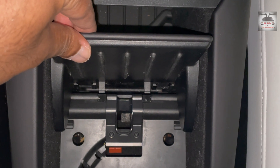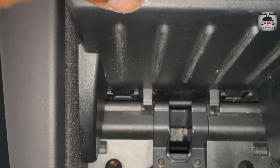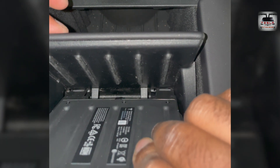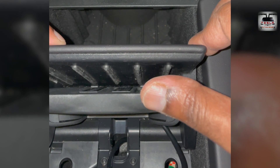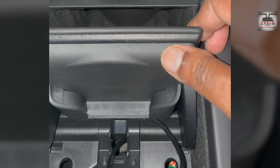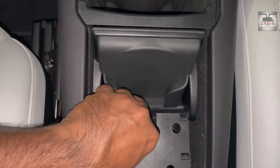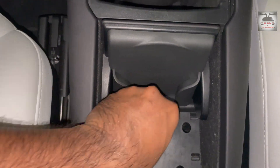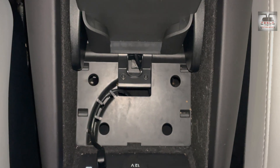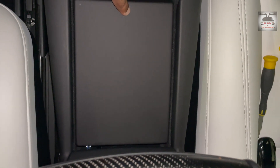As I slowly pull forward the door, you can see there are two clips at the depth of the door. There are tabs on the charger which perfectly fit to these clips. Let me remind you — my Tesla is a 2018 model, and now I just need to plug in this new charger and it'll work. Feed the wire through the hole in the bracket, then feed it back from under the floor onto the floor of the cubby hole. Use the clips and wire track to secure the cable and plug the USB into one of the USB ports right there. You can even close this door without any problems.